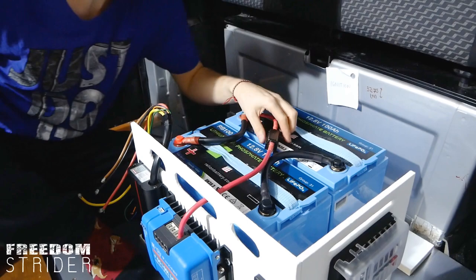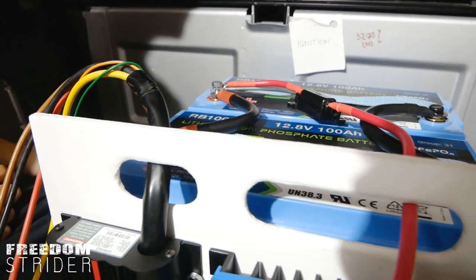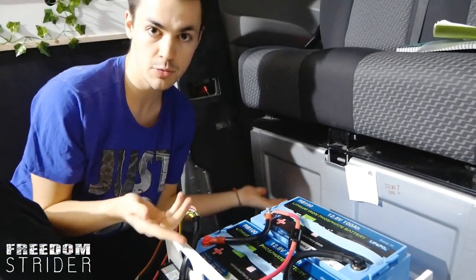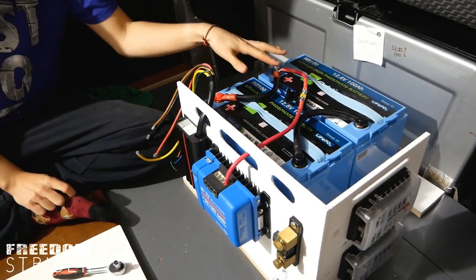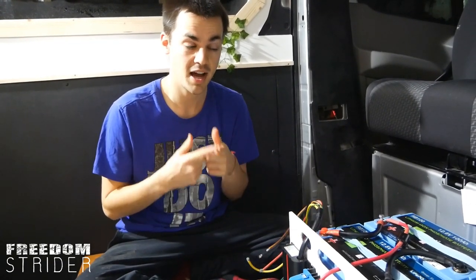It's hard to make out the fuse with the flashy batteries, but you can see that's the fuse. We will get around to labeling everything — we can put the label on the fuse holder so we know what fuse it's for, so this one can be labelled 'MPPT'. Until everything is connected up on both the positive and negative end, we don't have to worry about current flow. We're going to connect everything up first — all the negatives will go to the shunt, and then the shunt to the battery will be the very last wire we put in.